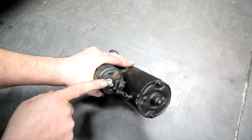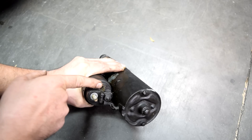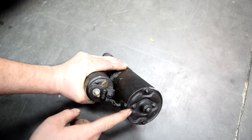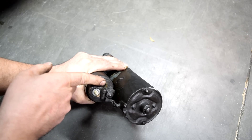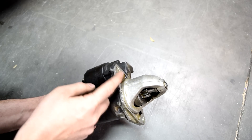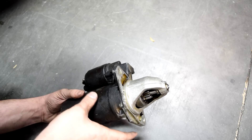So a constant battery supply regardless of whether the key is in the ignition or not, and 12 volts here only when you turn the key to the crank position. And 12 volts from this post to your starter motor only when you get 12 volts supplied to this signal post. Since your starter motor is attached to your engine block by way of these two bolts, it gets its ground from your engine.